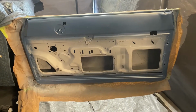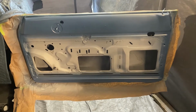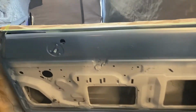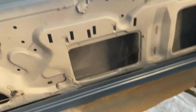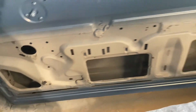Should have made this video about how to use aerosol paint, but I've got to be honest, I've been building model cars since I was like 11, 12 years old. So, call it finesse, whatever you want to call it, but you've got to shake it constantly. It looked like just now on that second time I probably did four coats, but the thing is, I'm just laying light dusted coats over this. It's metallic and we want an even finish. We don't want blotching in the metallic.